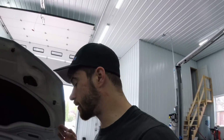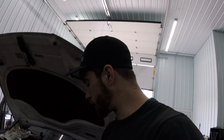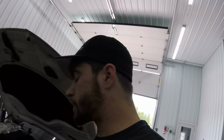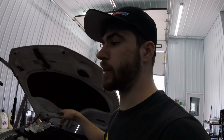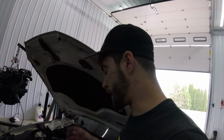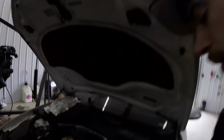Now I'm not entirely sure if it disconnected when I lifted the harness up, or if it was disconnected. I always thought the car seemed like it was not building boost the way it should, which obviously I know it wasn't. After I put the downpipes on, it felt a lot better. I didn't get to do any logging because I haven't hardly driven the car since the downpipes, but it felt way better. So I kind of gave up looking for a vac line. I had looked over it, but I didn't give it much thought. So now I did find it.